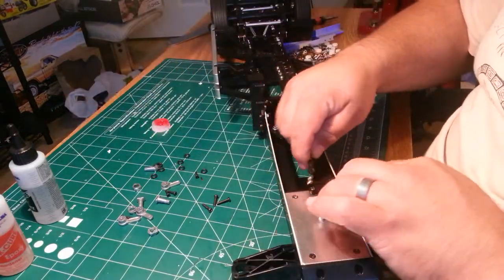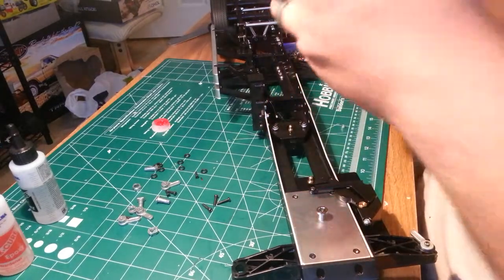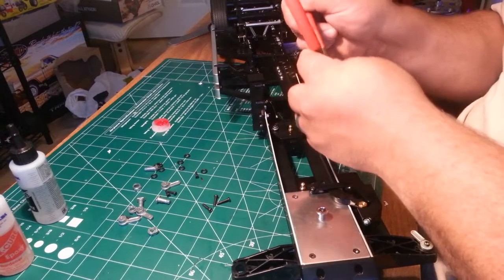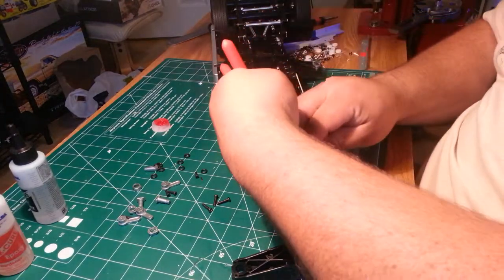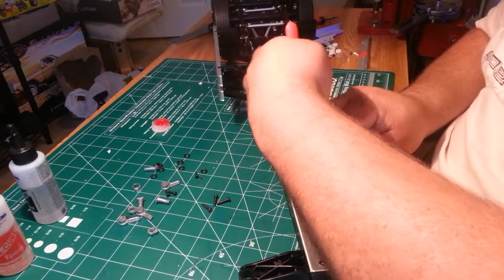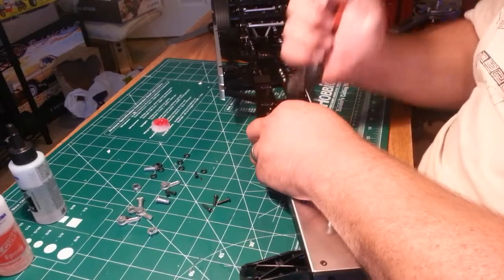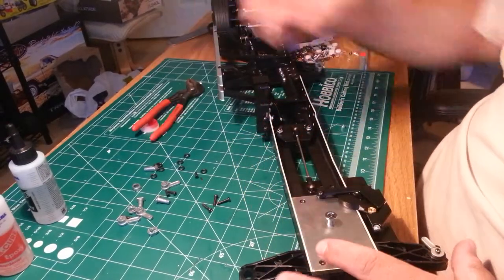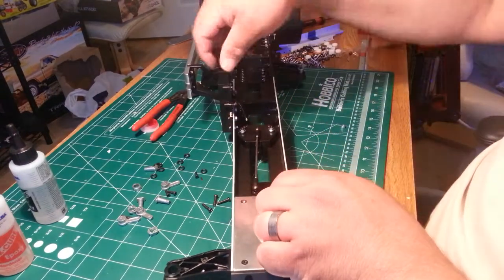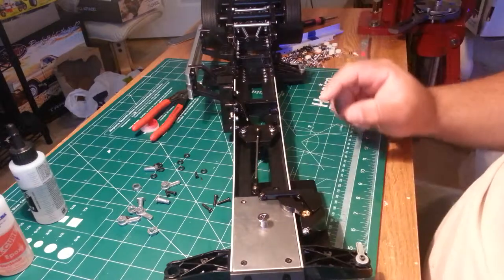We'll just pop on our arm — there's always a little trick to it. I just use a pair of channel locks; that's the best way I've found to do it. Now when you back your trailer in, you hit this little lever here, which pushes back on this part, which releases your leg. That's how it's done.